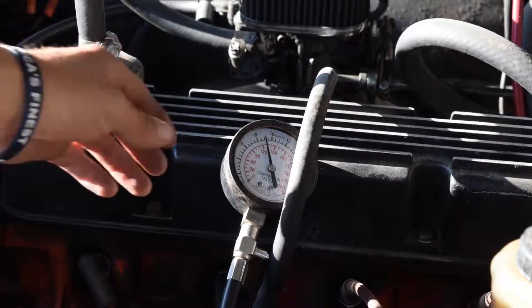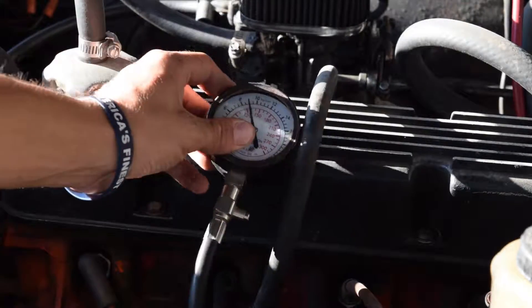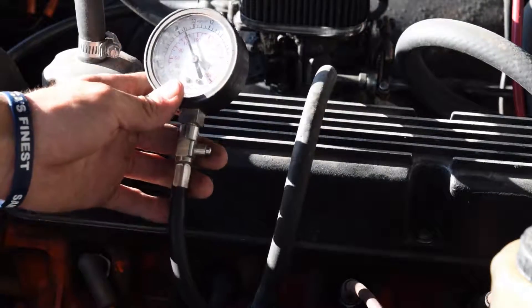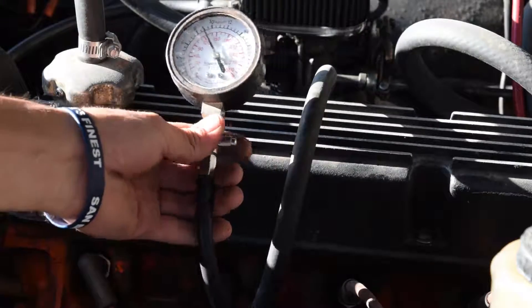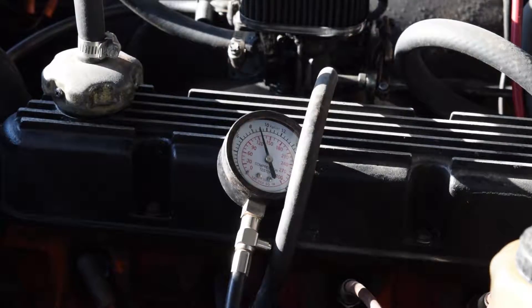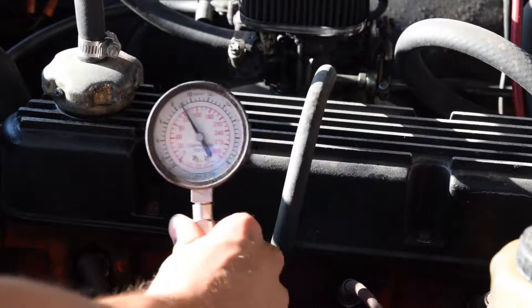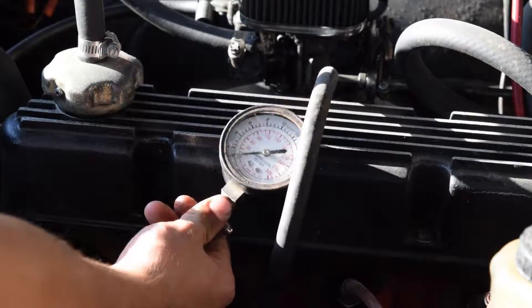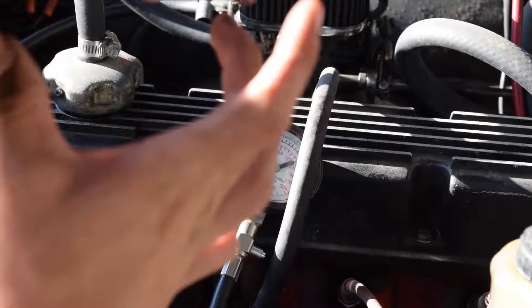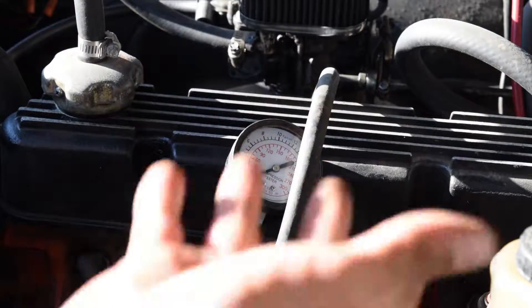It actually did raise — looks like it raised the pressure from 115 to 122, so 7 psi pressure. That's still pretty low compression for it. This engine's probably just worn out, needs a rebuild — gaskets and everything. And I don't know if I'm the guy to do that to this engine. But if I do, I'll definitely make a video on it. I might put a new, stronger engine in it and I'll definitely document that. Not looking so good for this engine. It still runs good — once it's warmed up it sounds alright. Oil raised the compression a little bit, and the reason it raises the compression is that it will seat the actual rings around the piston and create a tighter seal, which raises the compression up.